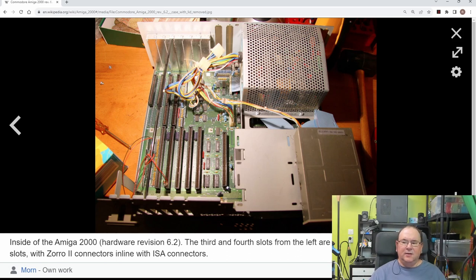This was the first Amiga that actually allowed the usage of expansion cards, and for its day, it was rather interesting. It had the larger slots on the right-hand side of the unit. It has a CPU MMU expansion slot, and then it has so-called Zorro 2 card slots. The interesting thing with the Zorro 2 bus was the idea that you could have a bus master switch option, so you could put in a card that could actually take over the whole computer.